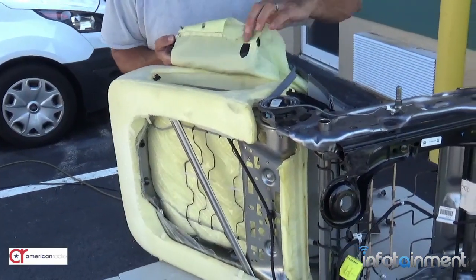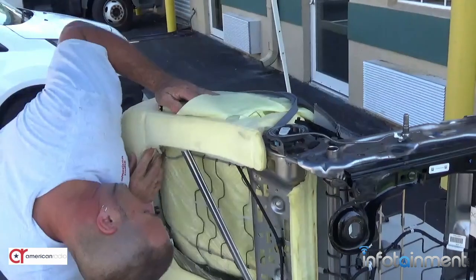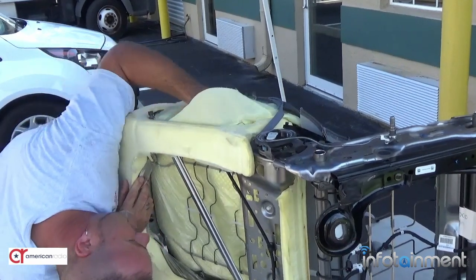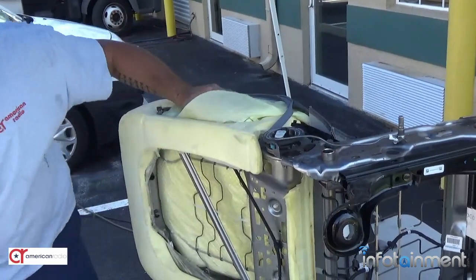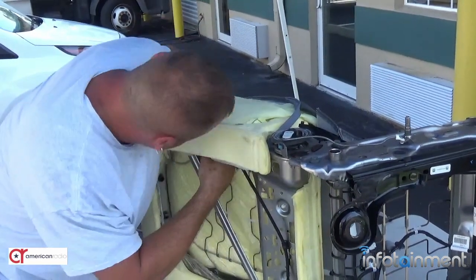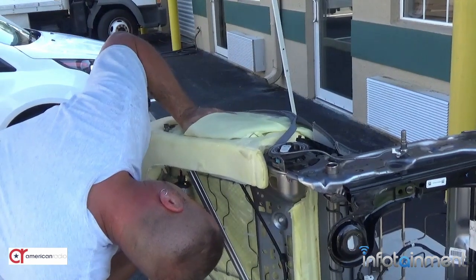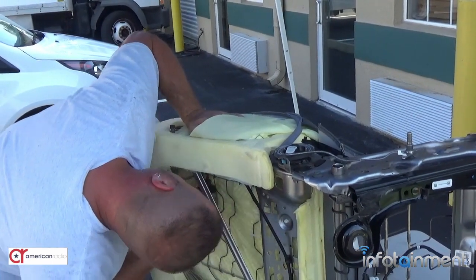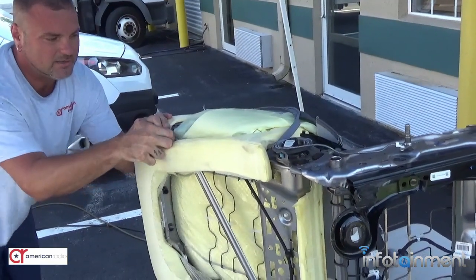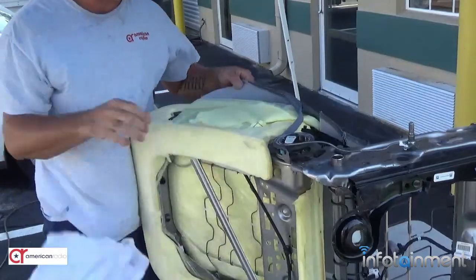So get your leg that locks in the bottom, get your two screws, and plug it in last. Just gonna look under, line her up. I kind of hand start those just because they are a fine thread. Airbags are expensive. Seems like a share of them get replaced. Snap it in, it locks. You'll hear it snap, and then you'll snap it in with a locking pin. That way you're sure it's locked in.